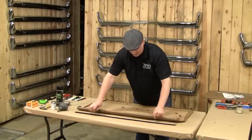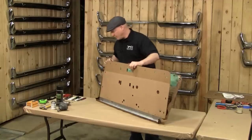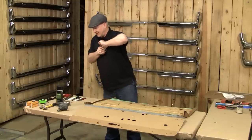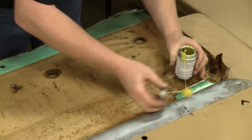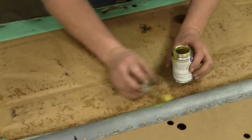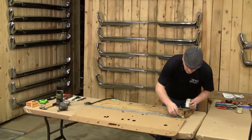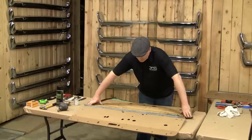The beltline strip we're going to install will not be impeded by these staples — they're in a different location on the reproductions versus the originals, so we shouldn't have a problem there. We've checked everything for alignment to make sure it aligns right. We're going to get some contact cement, open this up, and just lay down a bead of it — doesn't have to be super thick; we just want it to keep the top of the vinyl from shrinking back off of the backer panel. Get the sides real good. Now that that's done, we can go ahead and flip the panel back over.